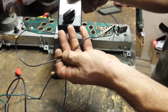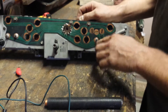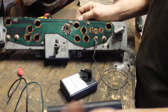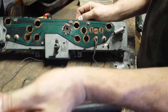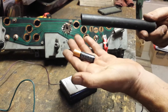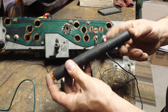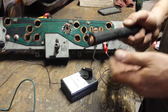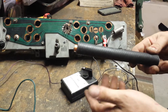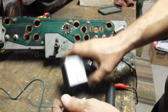There's a lead to ground and a lead to the sensor or the back of the gauge. For our fuel gauge, the pin I know goes to the sensor — I'm going to take my tester and put the alligator clip on that. The short lead with alligator clips is going to go to my power source, which is the other pin. The power source is essentially AA batteries — they're 1.5 volts each. I've got four of them in a sleeve made from a piece of 5/8 heater hose. They fit in snugly and you get contact with all of them. It's putting out 6 volts, so the gauges should show a little bit high. If you want accuracy, find a 5-volt source and you'll see exactly what your gauge is doing, but this is really good for testing.